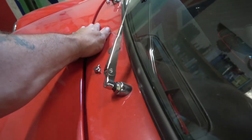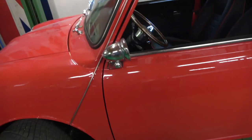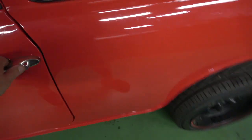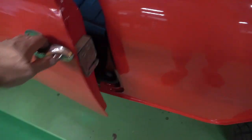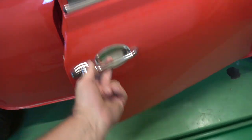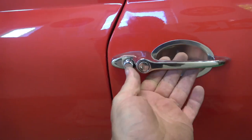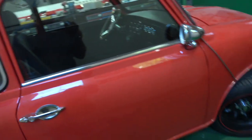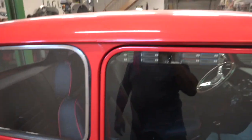The bonnet is better now — it's pretty much in line. The hinge on that side needs to come down just a slight bit. We've tracked the car up and the hinges are all done. Not many Minis where you don't have to slam them — which is pretty good. Same on the other side. One hinge was brand spanking new and the other three needed work. Very easy to open. There's absolutely no movement — if I open this you'll see no drop in the door. The lines are pretty good all the way around. Quite happy with that.